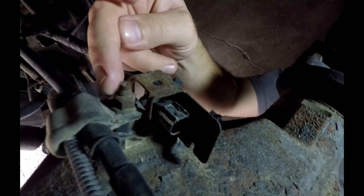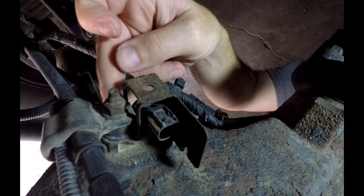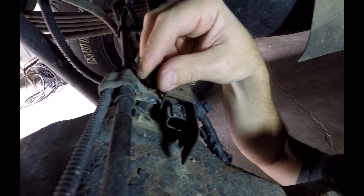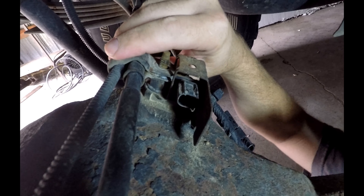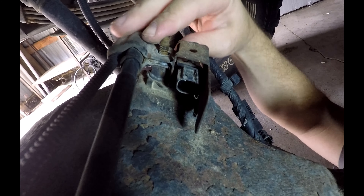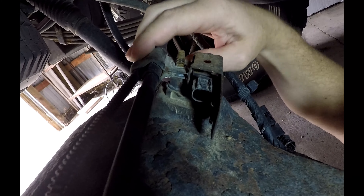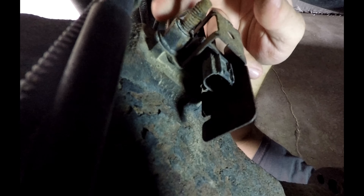Slide that out, then undo this little deal and pull it out from the top of the bracket. There's a bolt or nut right here — we're going to take this nut off, and then there's another one underneath. Remove that, take the nut off, set that aside. This piece here just slides off — it's holding your brake lines and stuff. Just lift it up off the top here, like that, and it rotates a little bit so it slides right off.